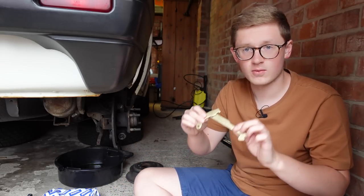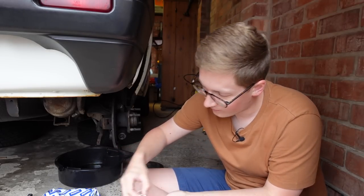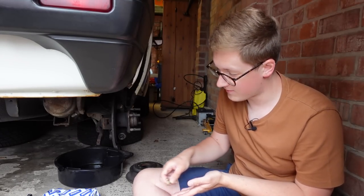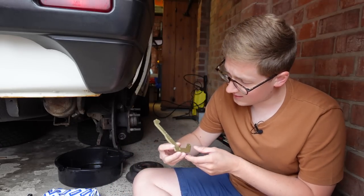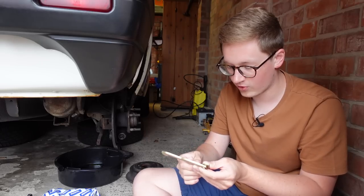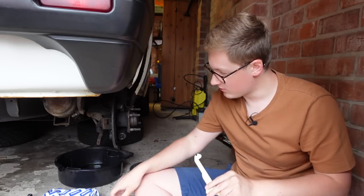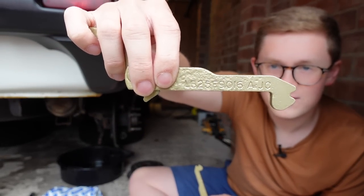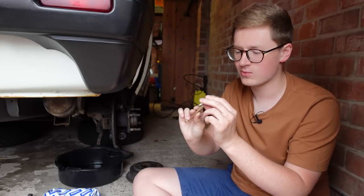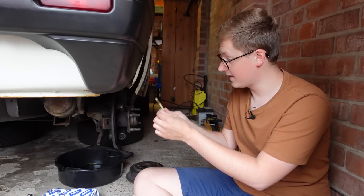Back out to the car now after a few days letting these cure. The handbrake levers are looking ace and completely free, and I also have all the shoe locating pin things. They've all sprayed up really nicely and come out of the Deoxy treatment really nicely. Spraying them isn't ideal — they should actually have been plated, but there are no platers near me that will do small jobs. It's just not economical. You can see all the part numbers in the levers now, which is great. They won't last as long being sprayed as plated, and it's difficult to get paint into the pivot, so I'm going to make sure I protect that pivot when I assemble everything back together.